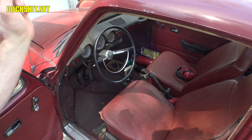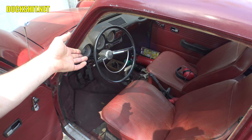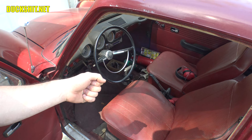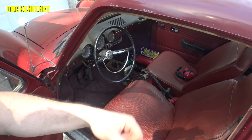The plate on the front isn't even original — it's just a piece of sheet metal because the original plate was missing when I got this car. Needless to say, the original plate has turned up; I found it in a box full of junk, so I'm going to sandblast it and reinstall it. I still need to remove that other bolt — chances are I'll end up cutting or breaking it off and re-drilling and re-tapping the chassis. But I managed to get the shifter shaft out, put it back together with a brand new bushing, and now I can find first, second, third — all gears, no problem. The bushing was definitely the problem for the first gear issue.